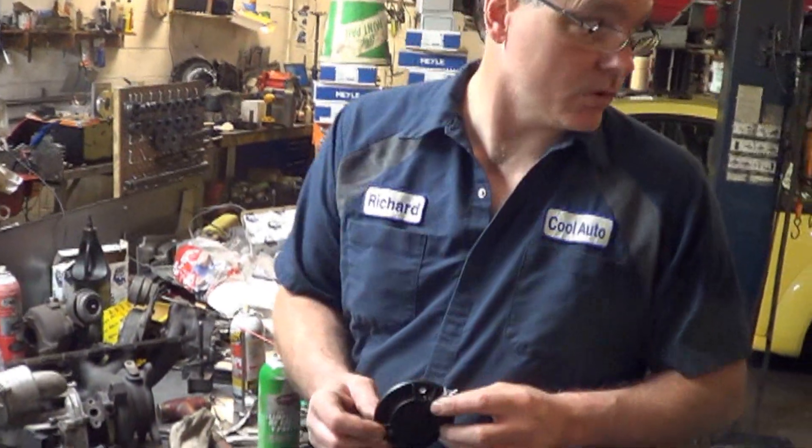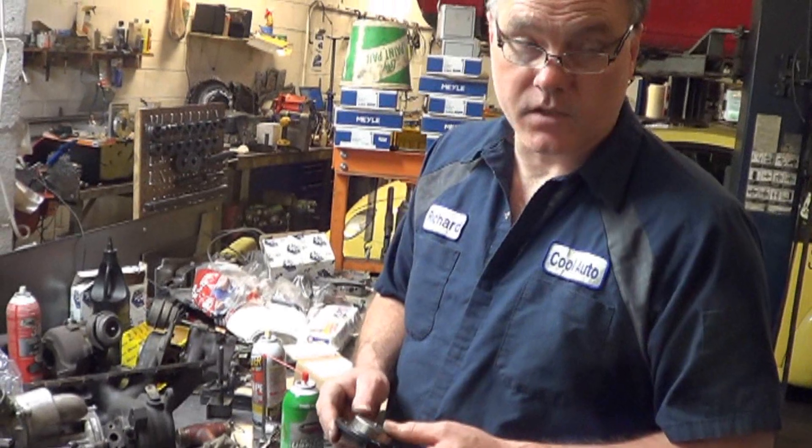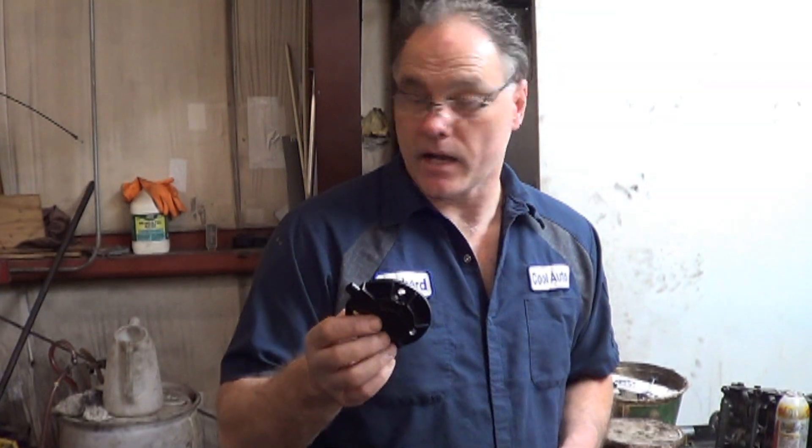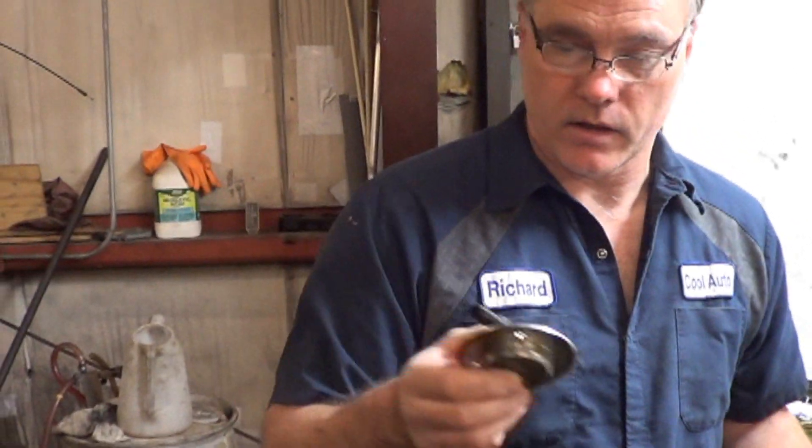This one is obviously a later one, a 2015, but they're very, very similar, and maybe that other one will work in place of this one, or maybe we can at least demonstrate on video how a free one looks. This is our cam adjustment magnet out of our 2015 Passat with a CPR letter-coded engine. You can see that one's plastic. This is the cam adjuster magnet out of our 2012 Volkswagen CC with a 2-liter TSI and a CCT letter code. This one's made out of metal, but they are almost identical. This one may even work in there.